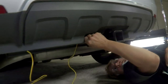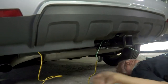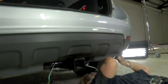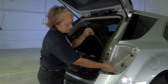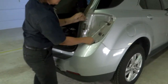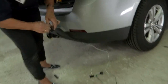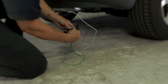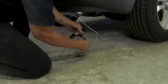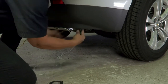You want to center the attachment that plugs into the actual trailer. It's always best on the driver's side. We'll attach all this, zip tie it all up, and make it nice. We're going to take this line and run it in behind all these brackets, running it down from top to bottom. Using our trusty line-running tool, we'll tape the little end on it so we can pull it up through. There's enough space on this vehicle that it won't have any problems coming through the hole.